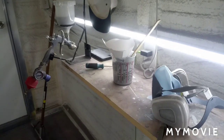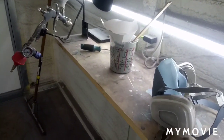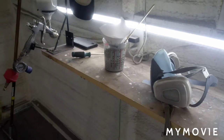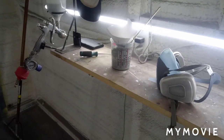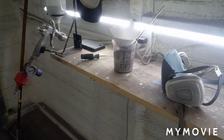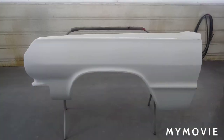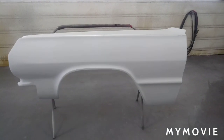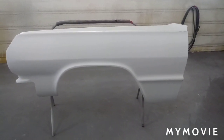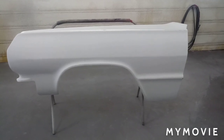What we're doing first is sealing it with epoxy. We mixed three ounces of epoxy, three ounces of activator, and two ounces of reducer. The plan is to seal it, wait about half an hour, then come back and spray hopefully two to three coats of the silver, then the candy red on top, and then two or three coats of clear.